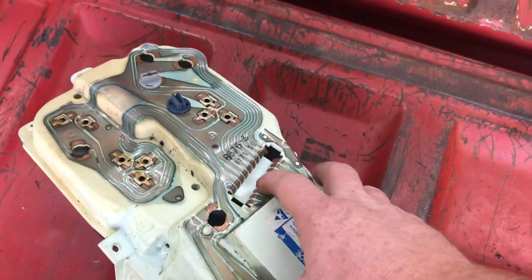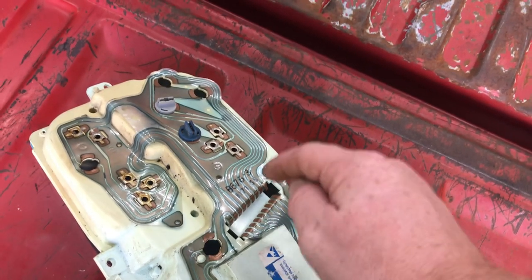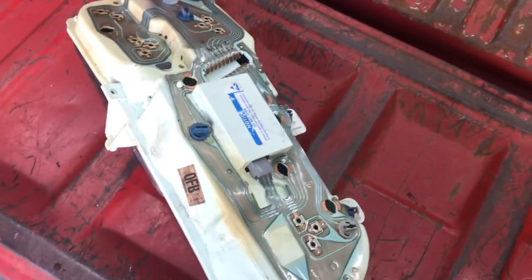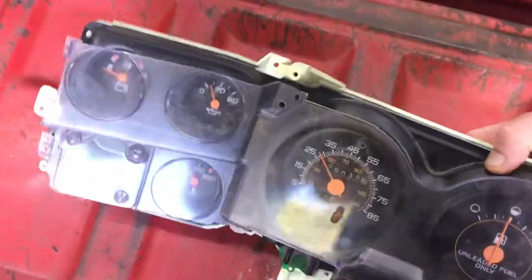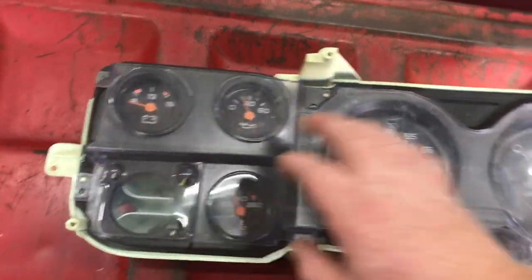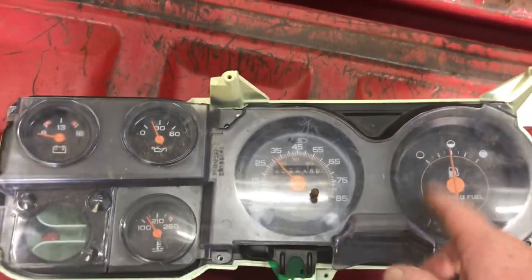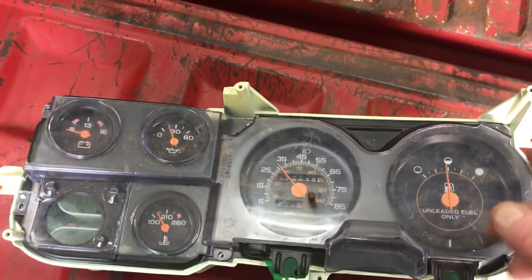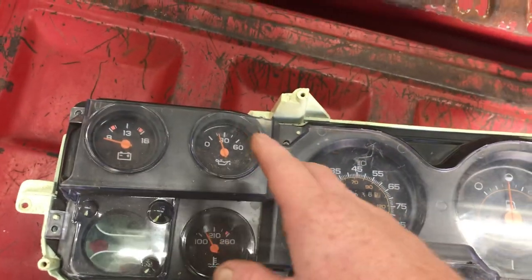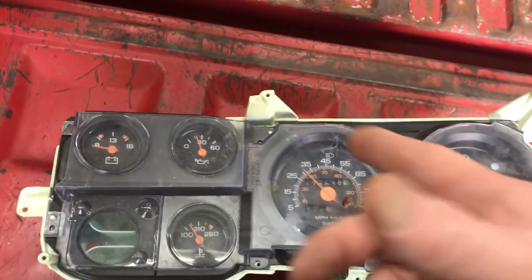You can splice into your harness on that wire and rerun the whole wire all the way to your tank if you need to. Not a lot to these, but they can get a little aggravating. I actually had to call my dad and get a little refresher course — he's fooled with a lot of this stuff over the years, so it's good to have a source like that to help you along. Anyway, since I've been fooling with all this it's just sort of come back to me. Just some common issues: if you're having trouble, it's worth a shot — take your gauges out, pop those little clips out, clean everything up, clean the board up, mash them down, tighten them back up, and pop them in so they're getting a better connection. That'll probably solve your issue.